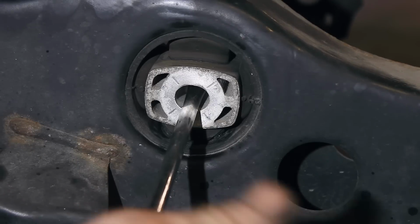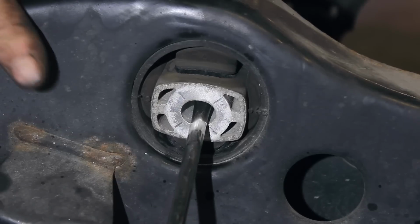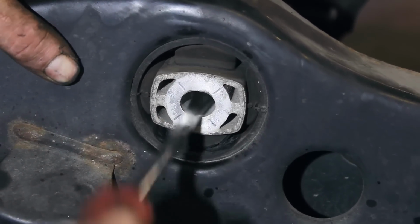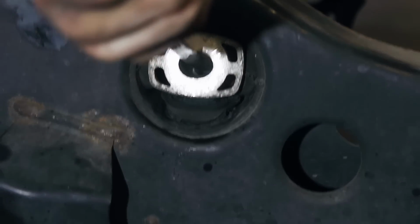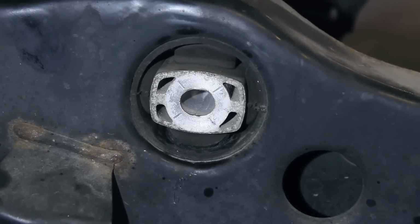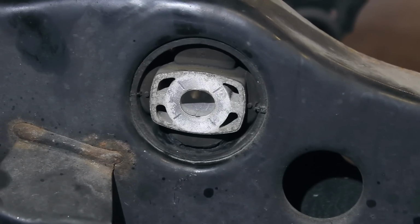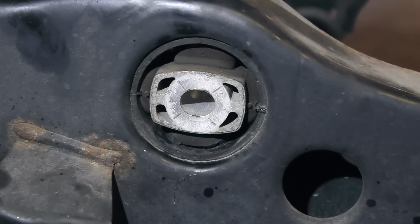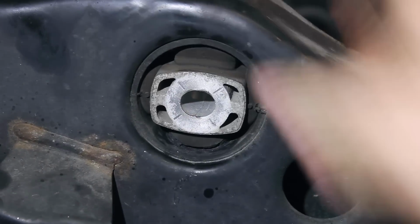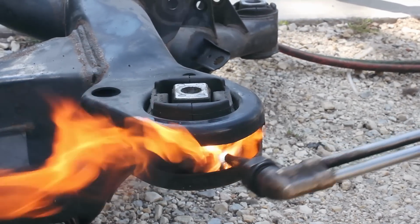So Joe just showed me here that this rear diff bushing was in bad shape. Look at that. As you can see, if he pries on it up or down, the whole thing, the bottom is way worse. See that? Wow. Yeah. That's why you upgrade your differential bushings. Thankfully I got those black PowerFlex ones to throw in there, and I'm sure this had something to do with wheel hop and maybe axle hop, but like I said, a lot of power on these and they're original, so it's definitely time to be replaced. We're gonna burn these suckers out now.